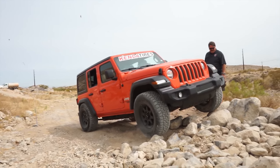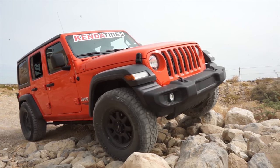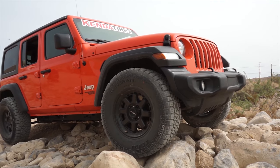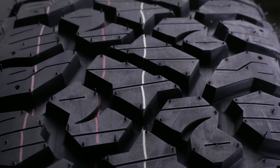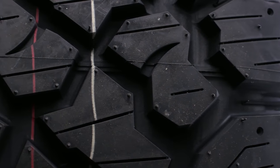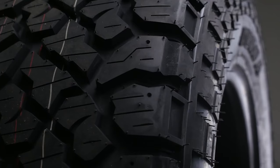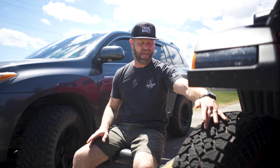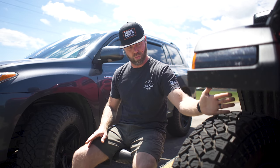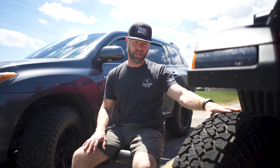That's a really great price for a tire that gives you long-lasting durability and still offers all the traction capabilities for both on-road and off-road performance. Starting with on-road: the center tread lugs grouped more closely together cut down on road noise and prevent that slapping sound you get with a more aggressive tire. The channel grooves are pitched at an angle, along with the center treads, so the tire contacts the road one lug at a time as it rotates.